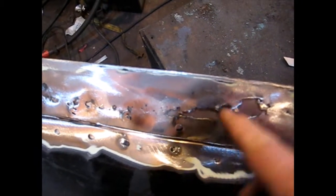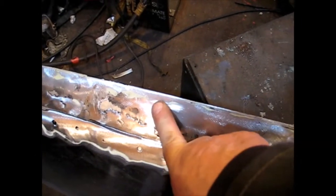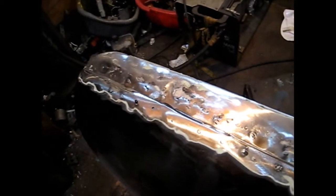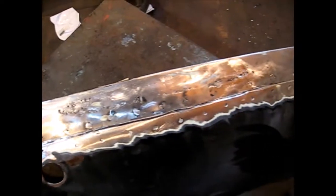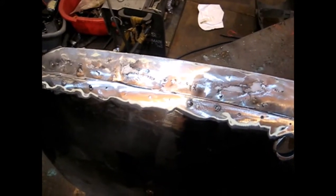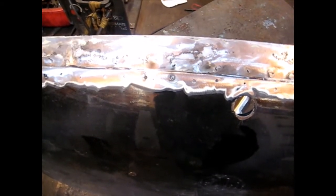I'm happy. I'm glad that I used this original piece of the boot. I know it's got holes in it — pin holes all over the place — but it's actually not rotten. All the rot's gone and this is reasonable metal. That inner piece at the end goes right up to here, so there's solid metal at the back of all this. When that's welded on, it could be rock solid — it'll not rot in my lifetime, and that's all I'm worried about. So I'll offer it up to the car and see how I get on, and then if it's okay it's just a matter of welding it all up, skimming some filler over the top, and giving it a coat of paint.